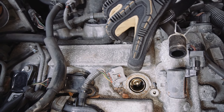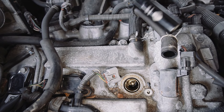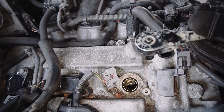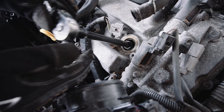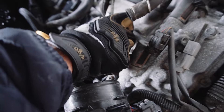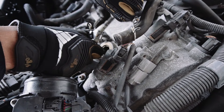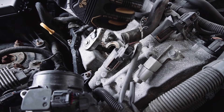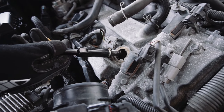Make sure you see there's a lot of dirt here on the side — do not mess around with that. You don't want any dirt going in there. We're going to get our socket extension and spark plug socket, take our ratchet, go down in there and get it. I've got my spark plug socket — we're just going to go in here gently, connect it, and simply loosen it. Sometimes these are a little bit seized because of the mileage or the age. It's going to grab onto the spark plug and come out with the socket. We got it — the spark plug's out.